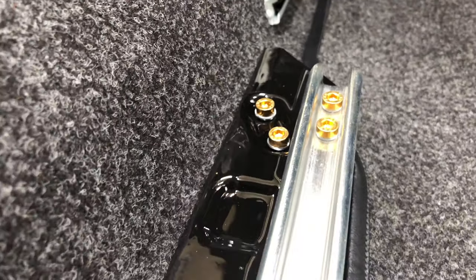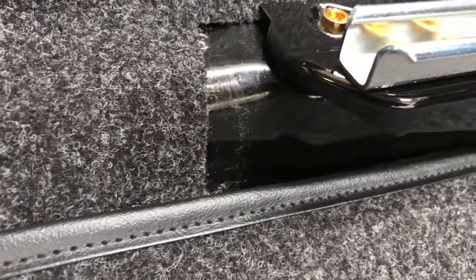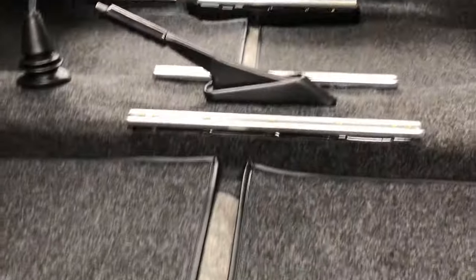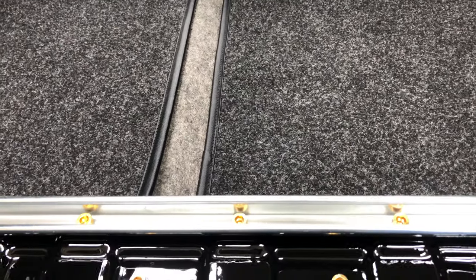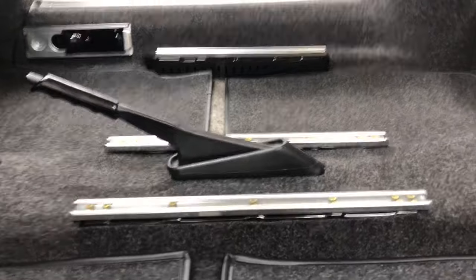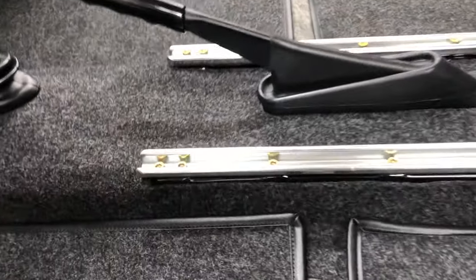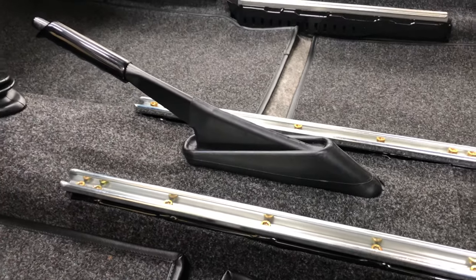A close-up look at our work here — everything seemed to fall back into place real nice. The only thing that didn't quite make it was right here near the back, a little bit short on my carpet kit, so I'll have to cut a patch carpet and plug that in there. Regarding fastener count: Stoddard calls out 28 for the set but they're talking about the seat rails only. You'll have an additional 12 bolts on your seat rail extensions. So you'll need 28 plus 12, and keep in mind the fuel line issue — if you've got that, you'll need shorter bolts for that area. On this car it's on the driver's side.